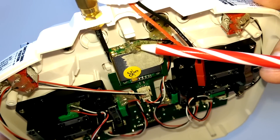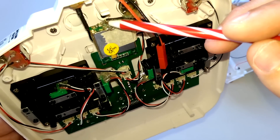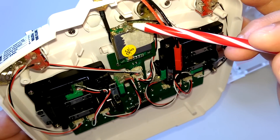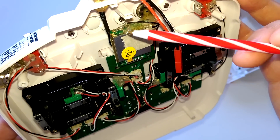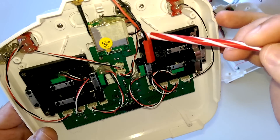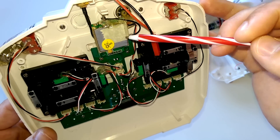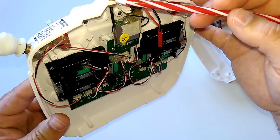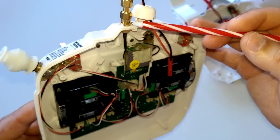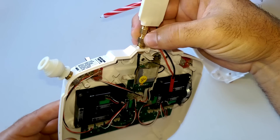You'll see it when you take off the old antenna — just take note of how it's soldered on there. Mine had a real hard silicone paint to guard everything and hold it in place, so you're probably going to have to scrape that off. What worked for me was taking the side of my soldering iron, heating that up, and scraping it off to get to the solder points. Once you do that, solder in the same manner as the stock one was connected and route your cable up in this direction. I drilled a hole just to fit the coaxial connector snug and comfortably, then run your coaxial connector through the top and the actual amplifier will just screw right onto that.